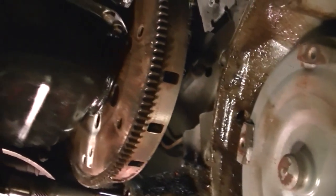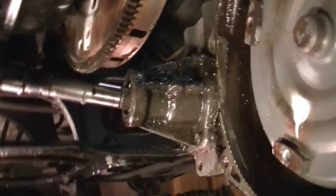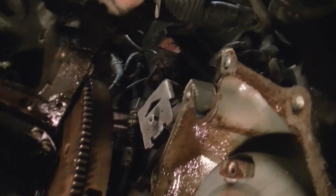I'm going to have to slide all the way across the axle there. I just kind of wiggled it and down it comes. Transmission is pretty much out at this point. That axle is pretty long. If I had to do it again I'd probably just pull the axle out - it might save a little time. The other reason I didn't pull it out is because I don't have a lot of room in my garage, but if I was outside I'd probably have just pulled both axles. Transmission is pretty much out now. I'm going to slide it off the jack and get it out of the way.